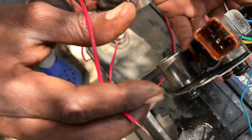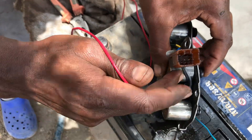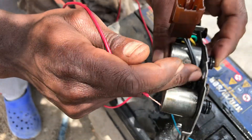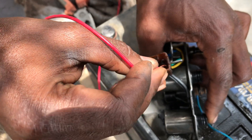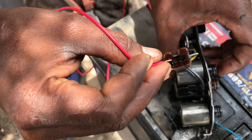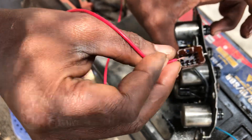So that's okay. I'll go around and check all the solenoids. This is the culprit — these are for gear number one and two. If I try testing, this cable goes down to pin number one from my right. There is nothing happening — nothing happening if I try to test. When I test, the other solenoids are working correctly.